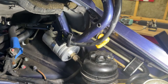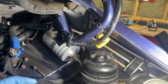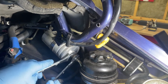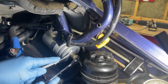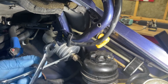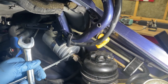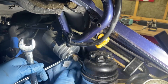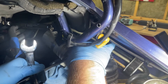We're going to try taking this fuel filter out. One of the things we have to do is we actually have to counter-hold this while we turn the fuel line. I do have a rag handy because I don't like getting gas all over the floor. I'm just going to tuck that up under here — I'm hoping there's not a lot of fuel left, but we'll see.